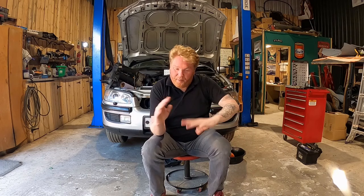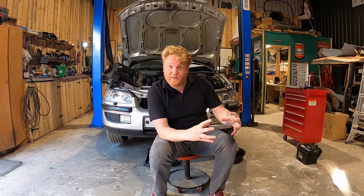And it's not happening. And I think it's not happening because there was something wrong with the ABS ECU. So I took it all out, ball ache of a job. I'll show you where it is in a second. And then I had to put it all back in, which I've done now. And I don't know if it works yet. I've done a quick fill of fluid and everything, but I'm gonna need to bleed it up properly when it's back running. And God, I hope it works.